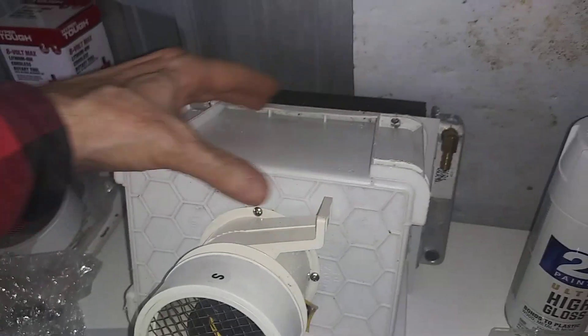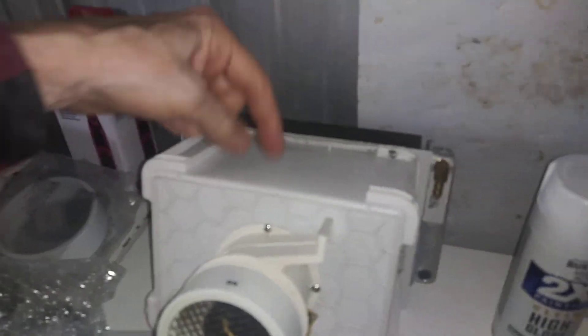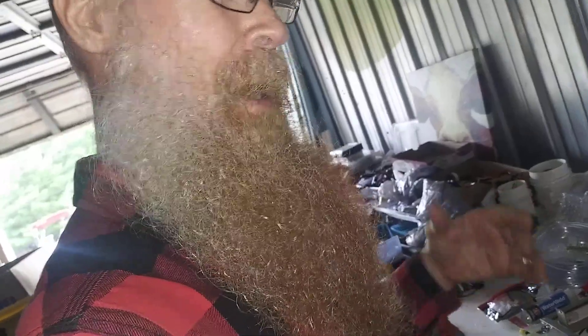So that's how that works and that's why I use an air box — because of the fan I use. As long as I'm using this little bitty fan on a big radiator, I have to have an air box to separate the two and grab air from the full radiator surface. If I just put the fan directly against it, I won't get air from anywhere else. I'll put some lists and links in the description. I hope this helps anybody wanting to use a PC fan or inline fan on a big radiator. That's why I use an air box with the three-inch or four-inch diameter fans. Bye-bye!